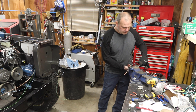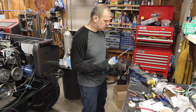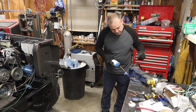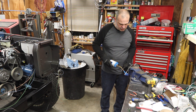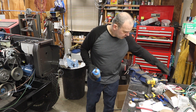Put it on my vise. Torch. I basically just heat it up inside and I see the flux start bubbling — I know it's time. When the solder basically drops off, I know it's full. It drips on the ground. Pretty simple.